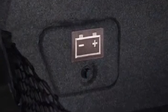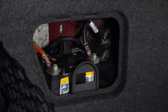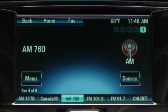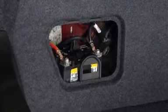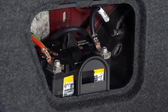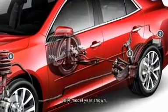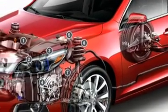A small auxiliary battery located in the trunk powers electric accessories such as the climate control system, power windows, and radio when the engine is cranking. The battery is small, similar to the size of a motorcycle battery, and does not take up any trunk space. This battery is isolated from the starting circuit and is only used to power the accessories during starter cranking.